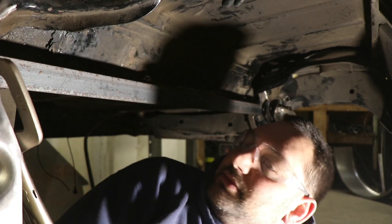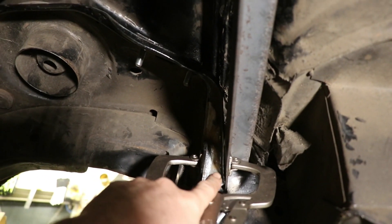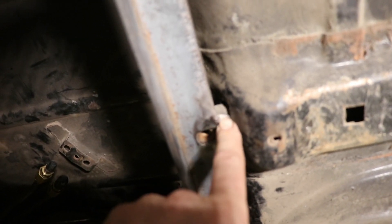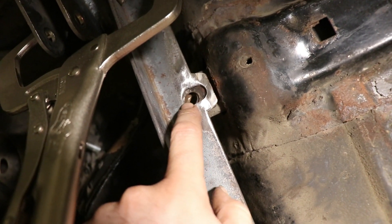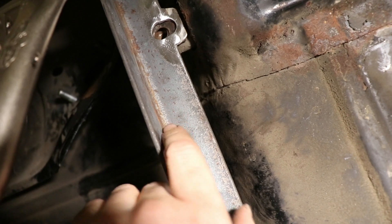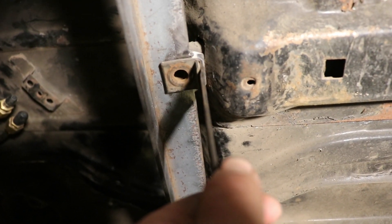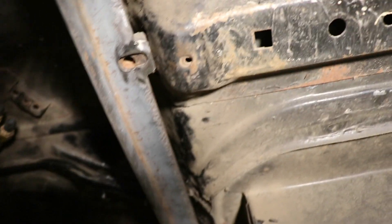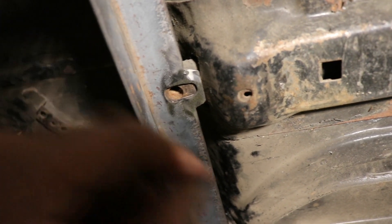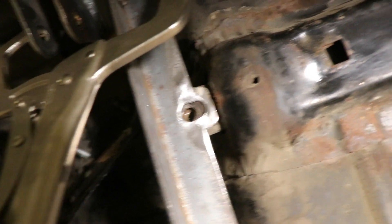I didn't even bother checking from the top because once I got it close, this inch-and-a-half angle actually lined up perfectly with the very bottom of the hangers on both sides - hell, that's good enough for me. That'll provide a nice strong weld down the edge of this into the frame. My guess on the hole positions was off though - I was pinched tight up against them, so I had to pull it out and grind them bigger so the bolt could start straight in there. But it'll still be fine, and this will be way better than it flopping around on the rusted-out trunk.